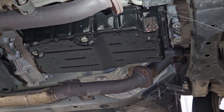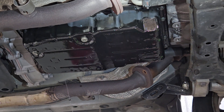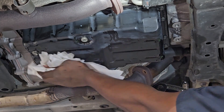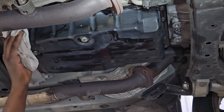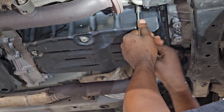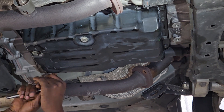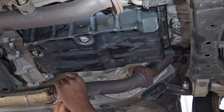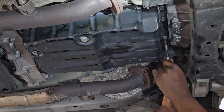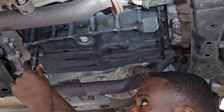You can spray with some brake clean now, but don't spray the valve body with brake clean, don't spray the solenoids with brake clean, and don't use an oily rag — keep that area clean. With the pan you can pretty much wipe it down. Go by hand again just to make sure everything's still nice and tight. Do a final check — there are a lot of bolts and you want to make sure you don't have fluid leaking anywhere. Make sure the drain plug is tight.